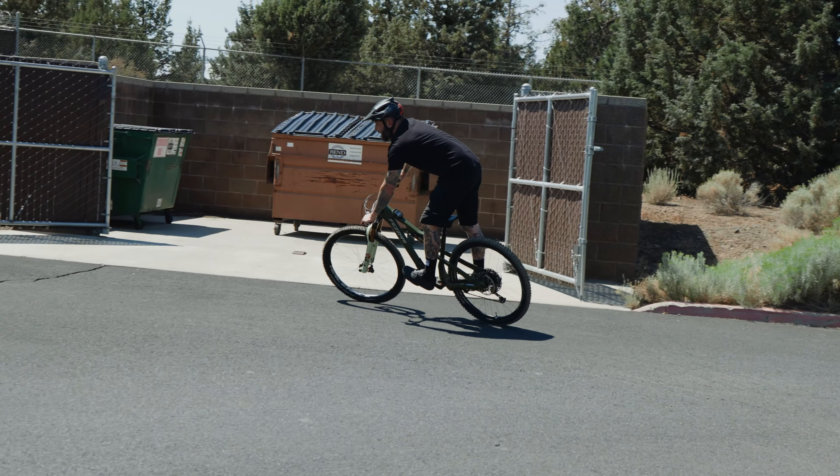With more layers comes less sensitivity. After going at 12 miles an hour on the Super Downhill, I want to go back to Super Ground and hit that curb again at 12 to see the difference in suspension energy transmitted up. The ring isn't traveling as high, meaning I'm using less suspension travel hitting the curb because the more supple casing is absorbing more energy. The suspension doesn't have to do as much work — but that casing over the course of a long World Cup DH track would leave you on the side of the trail. For everyday casual trails like in Bend, Super Ground is a great choice.